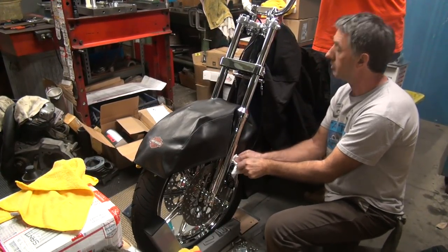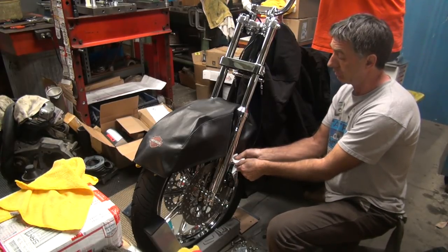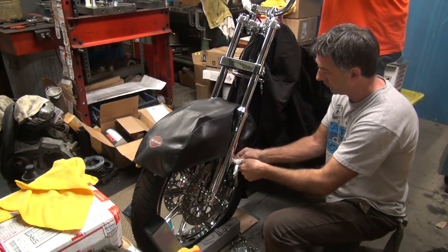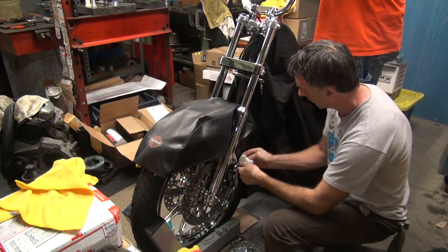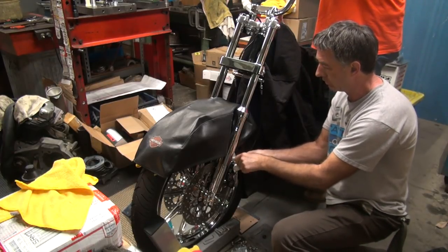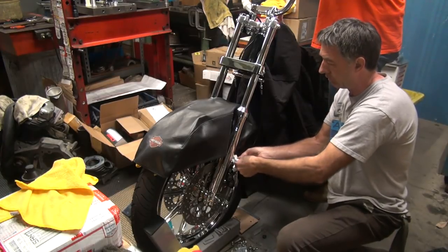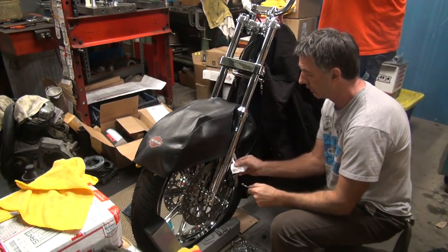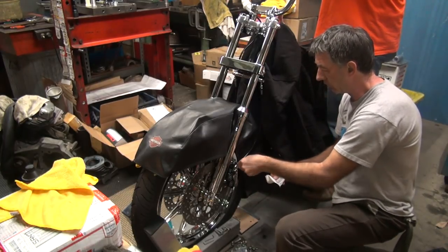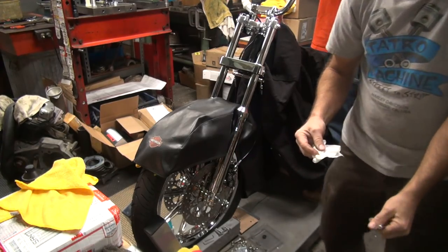Okay, give me about two or three pumps in a row to try to build up anything you got. Let me know you got something. And okay, holding it tight. Again, a little air came out. Do that again, I'll get it in. Alright, it's tight. Solid fluid. Got a big shot of air out though. That should have felt better, did it? Mm-hmm. Yes. Okay, let's go on the other side.